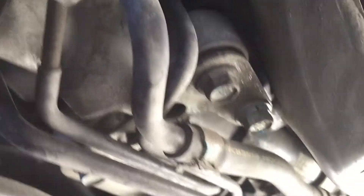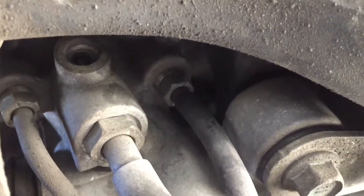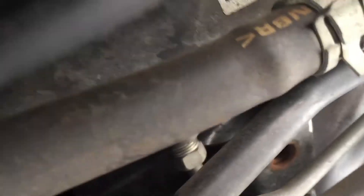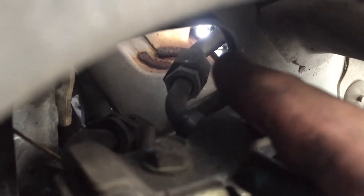You can see all these hydraulic lines — you don't really have to mess with all these lines just yet. Here's the steering input side, and if you follow up, there's your joint for your steering column where it comes through the firewall. We're going to take that bolt off. The nuts you can take off for the lines are over here on the passenger side. To drop the rack, you just have to take off this nut here, and there's also one right there. So I'm going to do that now and then we're going to drop the rack and start taking it apart.